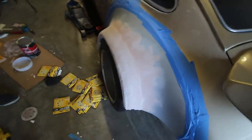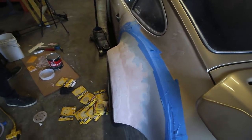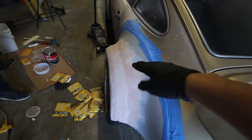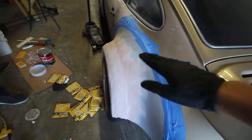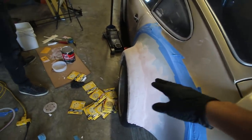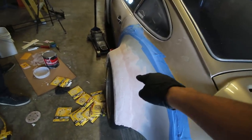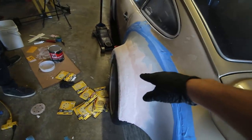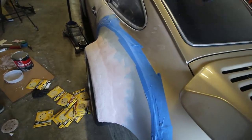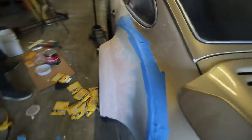So this is like any other bodywork: build up a nice layer of Bondo, sand it smooth, then primer it, spray it glossy so we can see any imperfections, then lay some fiberglass to make a mold. On the inside of the fiberglass goes the carbon fiber, that goes in a vacuum bag, resin gets pulled through the vacuum, and out pops a nice RSR flare. Much more confident in this now that we know our foam was good enough.